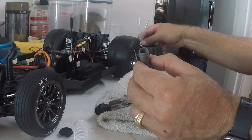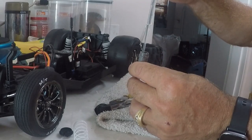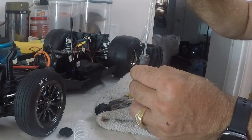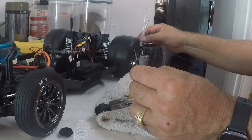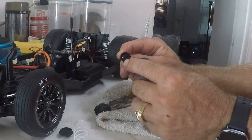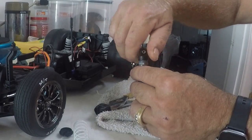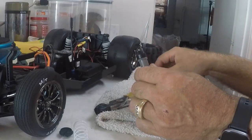When you get it to this point, you'll take your shock oil and let it slowly fill back in. Keep in mind not to overfill — remember that there is a bubble and you're going to use less than you took out. I'd say right about there is good. Now if your little plastic gasket came out — the cap boot — then you'd put it on bubble side down, push it into place, and line up the threads and put it in. If it stayed in just like mine, then you just put it on. Be careful with the threads and give it a quick wipe.